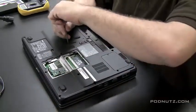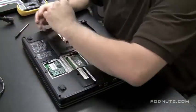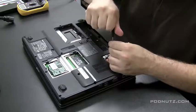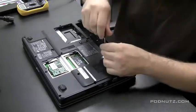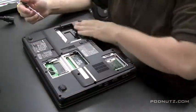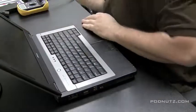I want to get everything out of the way since I'm going to be working on the motherboard. Anything attached to or touching the motherboard needs to go first. There's a little flap I lifted up that revealed the heat sink sitting on top of the processor, so I can take that off as well. Then I'll pull off the wireless card — I'll explain why that's important a bit later — and one screw pulls the CD drive out.